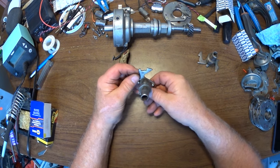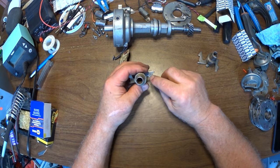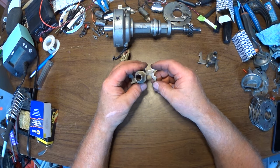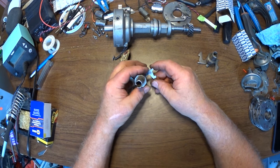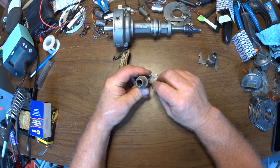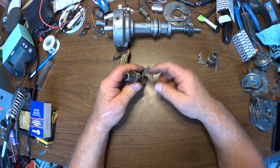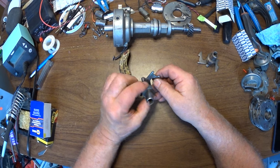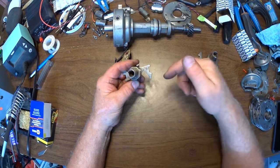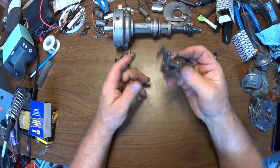So it is usable. The 15 would give you 30 at the crankshaft, so now you're stuck at initial timing down in the 4 degrees, 6 degrees, or 8. Some motors, like Betsy, when she had a 289 with the truck heads on it, it's an open chamber, and it took 40 degrees of timing of mechanical advance to get that thing to run strong. It had no quench at all, so 30 plus 10 initial would give me 40, and then make up the difference with vacuum.